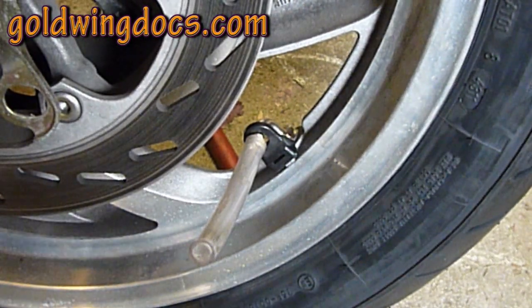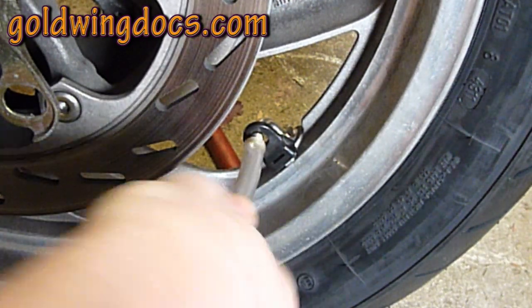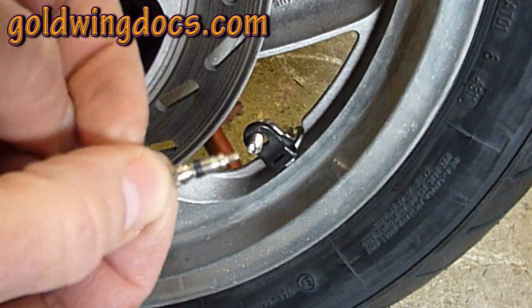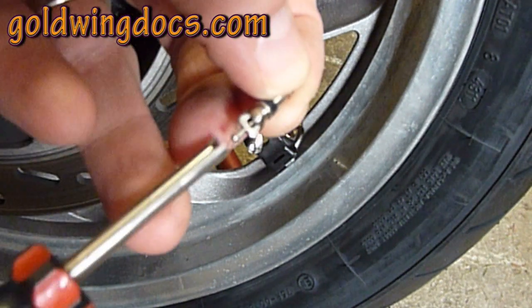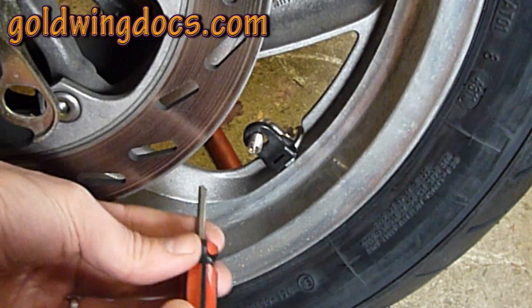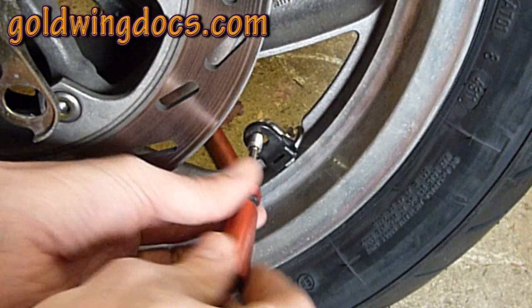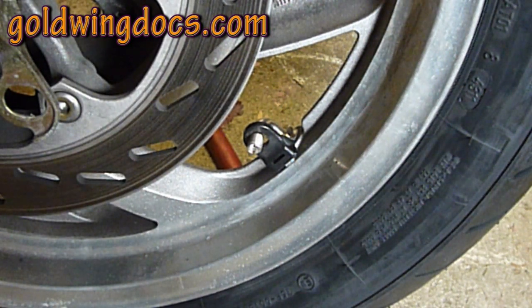When you're done putting all the beads in, unscrew the tube off the valve stem. Take your valve core — note that the end going in has a little bit sticking out, and the flat bit at the outside end is where the tool fits. Make sure you put it in the right way, gently insert it, catch onto it with the tool, and screw it in place. It doesn't have to be too tight, but tighten it enough that it's not going to leak air and you're finished.